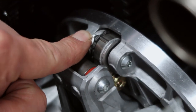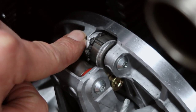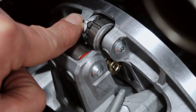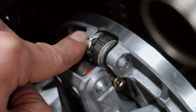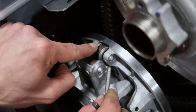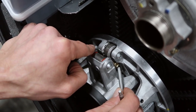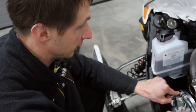The key here: 850s, you want them to rev between 7950 and 8050. 800 E-Techs are strictly 7900, you want to keep them below that, but these things have boost injectors so they're not nearly as susceptible to over-revving or having a problem with the injectors at high RPM. So 7950 to 8050 — if you're over that, you want to click down to a lower number, like two. Generally they come on three. If you're running 7800 and it's kind of warm out or you get a little lower on power, then you want to click up to number four.